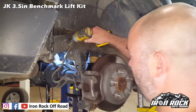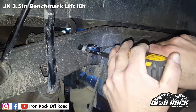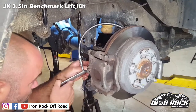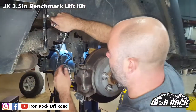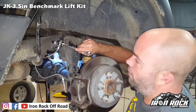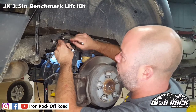Next up is our rear stainless steel brake hoses — using the original bolt going in at the same angle as the old one. One important note: break the flare nut loose before you remove the bracket from the frame. When installing stainless steel brake hoses, orient the hose carefully — if turned too far one way it rubs on the sway bar, too far the other way it has a funny twist. Find a nice happy medium spot; proper orientation is very important.